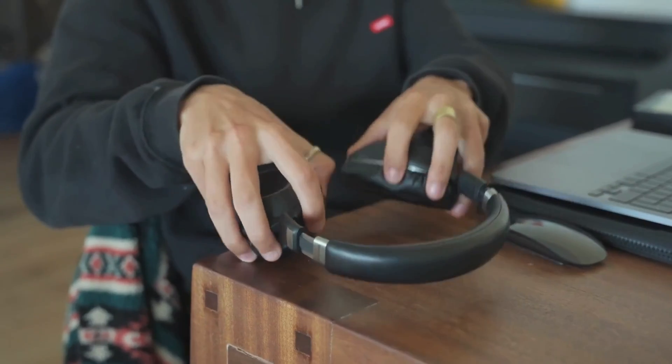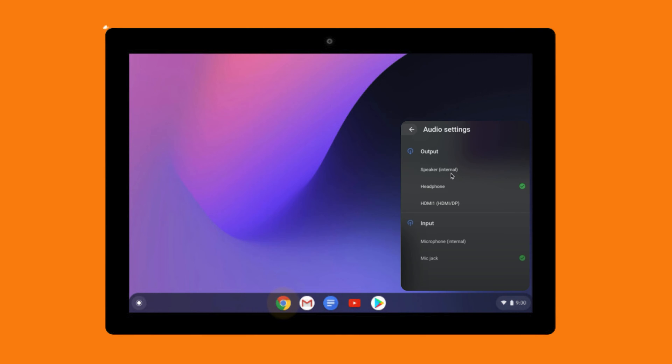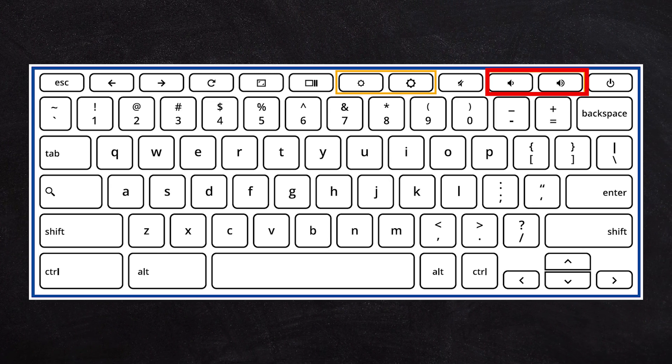Let's talk audio, starting with the basics. If you've got an issue with audio on your machine, check that you haven't accidentally muted it or connected headphones or another external device that has stolen the audio from you. Sometimes if you connect a microphone, that microphone will also have a speaker or headphone output component that can steal your output. You can check your audio settings down near the clock and choose your different audio inputs and outputs — you may find the issue is there. Also make sure you check both the volume keys on the keyboard and the software volume, just in case the keyboard controls are not working.